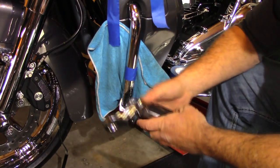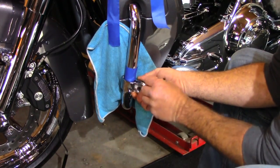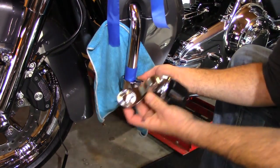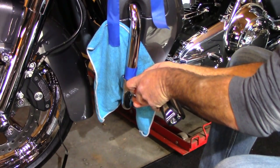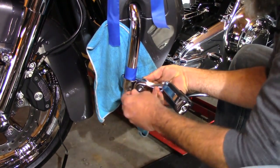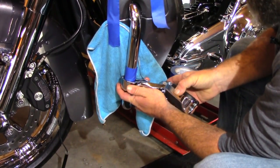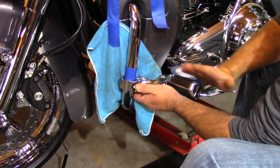Once I got my old ones off, I went ahead and installed my foot peg. I've moved this back up to the edge of the tape where I wanted it after I slipped it around the bar. I'm going to put my plastic washer in there, just kind of hold it with the palm of my hand, then slip the bolt back through here. Make sure that goes through the washer, get it all lined up, then I'll take my 5/16ths and just get it hand-started so it'll hold. Leave it a little bit loose so you can make fine adjustments — I need it to go down a little bit and angle in towards me.